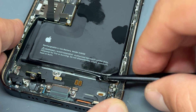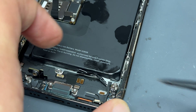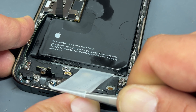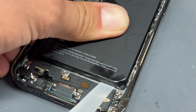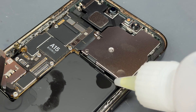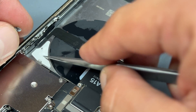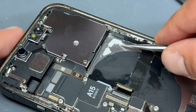Go for the big tab next — if you notice I'm pulling to the side it seems to make it a little bit easier. Try to get as much surface area on the tweezers as possible, spinning it around and keeping it nice and low. Wiggle it from side to side and hopefully you manage to get it out in one. For the top ones there's barely any adhesive holding it down — just squirt some isopropyl alcohol in there and use the black plastic stick. Once out, get rid of the old adhesive.